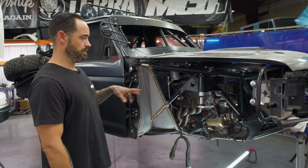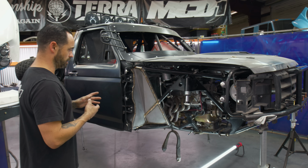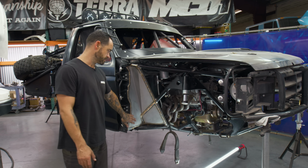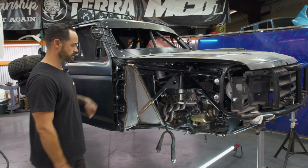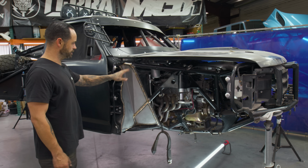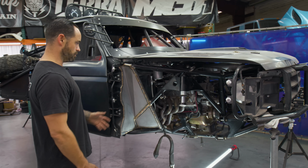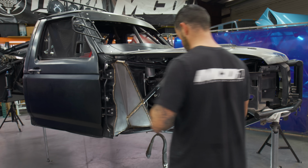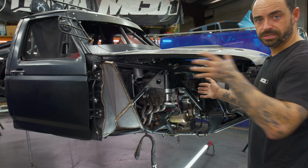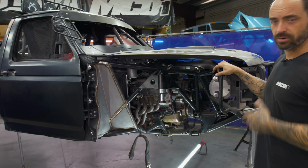So what we're doing here and what we've done is thought, okay, how can we make this work? What is going to get held up? Is a 40-inch tire even a feasible thing? The number one culprit was the sheet metal on the firewall, driver and passenger side. So not a big deal. This is a completely powder coated truck, so we do need to do some decent touch-up work repainting this area. But there were no issues as far as we put all the suspension on. We cycled everything, put the truck into full compression, locked the steering back and forth at compression, and it was close, but with a brand new 40 on there, it wasn't that bad.